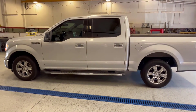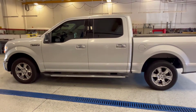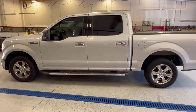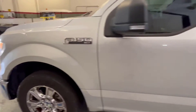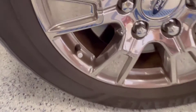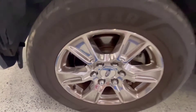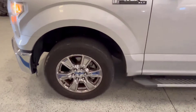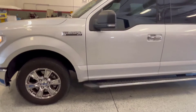This is a 2015 Ford F-150 that comes with tire air pressure sensors — direct sensors mounted in the wheels. This particular truck has a sensor fault. The sensors are mounted to the valve stem, and this one has a fault on the right front. We'll go through the process of checking that out, replacing the sensor, and reprogramming the sensors.